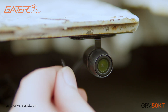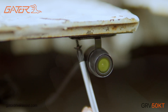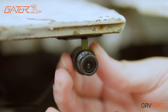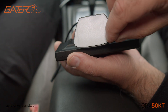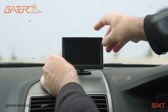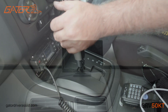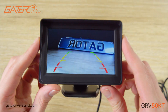It is recommended to mount the reverse camera with the bracket facing up, otherwise your view will be in the wrong orientation. You can also reorient the camera by unscrewing the cap and twisting the camera if it is not facing the correct way up. Install the LCD display by peeling the adhesive and placing it on your dash. After running the cables through the vehicle, connect the LCD monitor to the monitor harness and test the reverse camera, making sure that it appears on the LCD monitor when the car is in reverse.